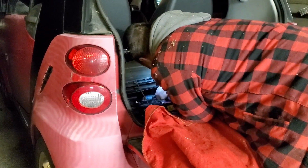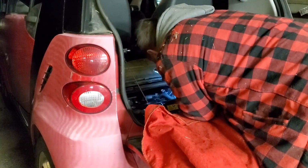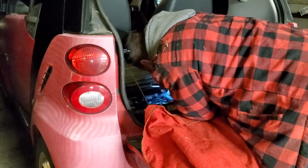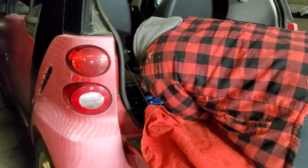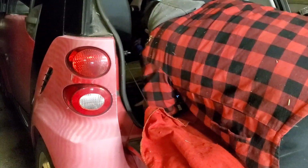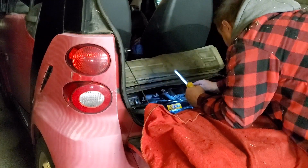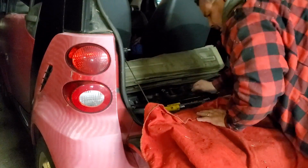I took this transfer hose off right here. Warm. Took the hose off right there, and I took the cap off the reservoir, the recovery tank, whatever you want to call it on this bottle, and let it gravity bleed. Since it's higher, it'll come up into the engine, into the block. And that's almost level with how high the coolant should be in the cylinder head, by looking at it.